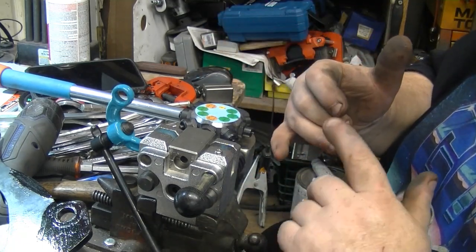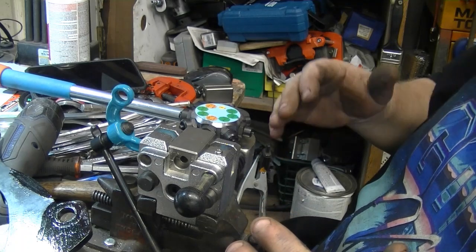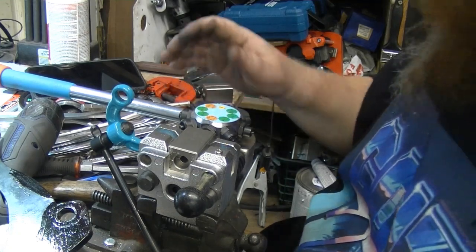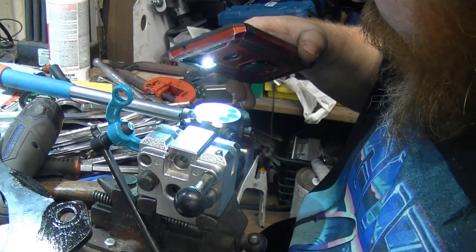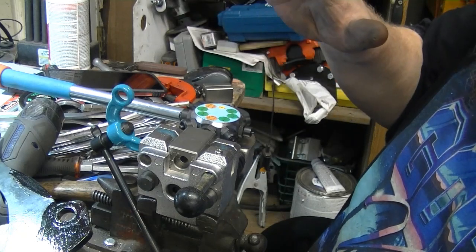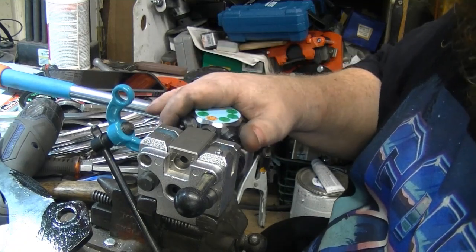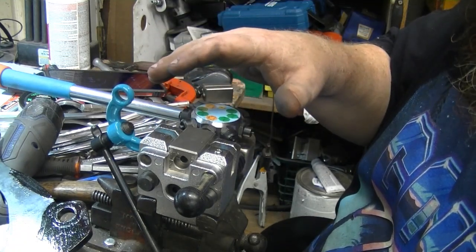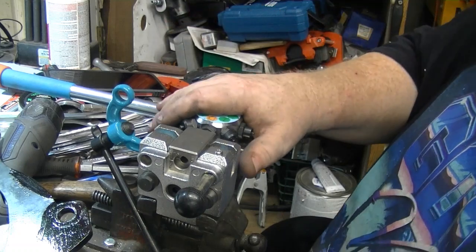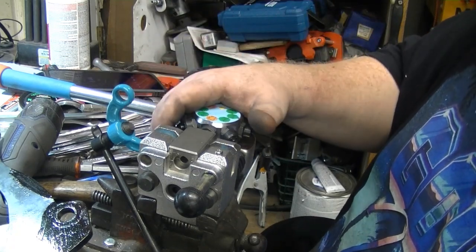Like I said, it'll do bubble flare, double flare, and single flare. And you can do 3/16, 1/4, and 3/8. And I think it does 5/16 too. We'll check. Oh yes, it does 5/16. My bad. So, anyway, under 200 bucks. If you need to flare a bunch of brake lines like you're building a car, you can't say that this is a waste of money. This is a time saver. It makes the job easy, and yeah, I'm really very happy with buying this tool.